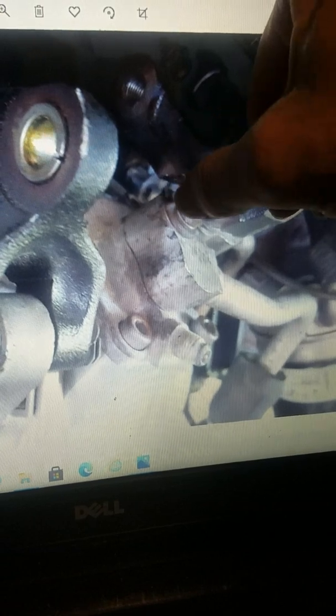Anyway, the next problem you're going to come across is that the power steering bracket still bolts up, but now you have these hoses that are not at an angle to go around the bracket. They're sticking up right in the bracket. And this bracket has been ground already, but you can see that it used to be about that big right there. So there's no way that was going to fit. This is what you hear people talking about, the grinding mod.